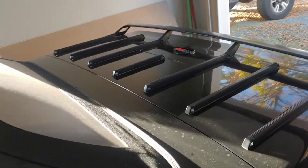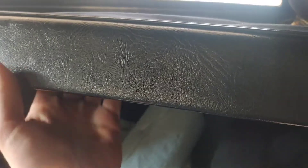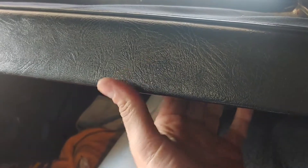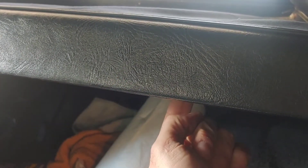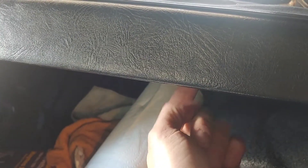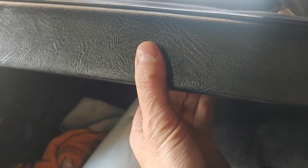Now, behind the back seat is the latch to release the back of the roof, and there's two pins that are latched into this cover back here — one here and one on the other side, same place. So I'm just going to grab behind the seat where there's a little detent, put the seat back, and just reach underneath this package tray, or back dash, whatever you want to call this. Right under here there's a little release handle. I got this cable at Coastal Corvettes in Mims, Florida — used, because they're pretty well impossible to find.